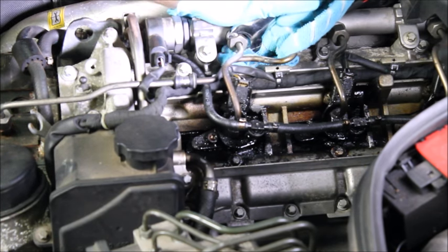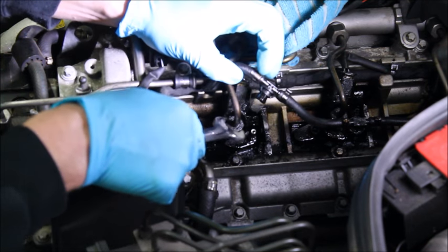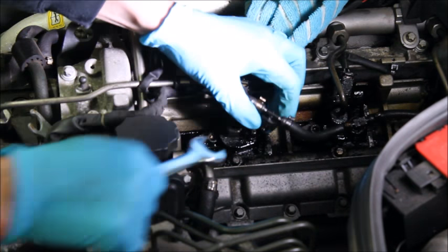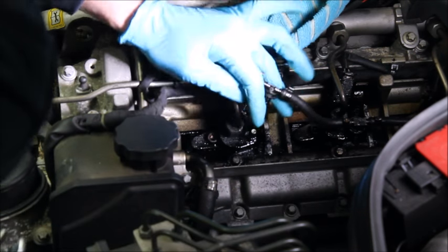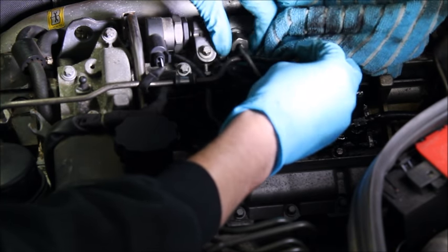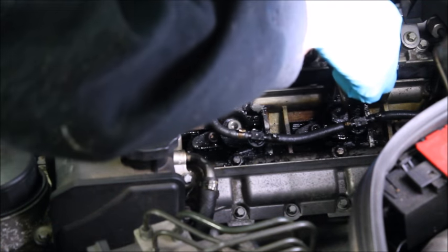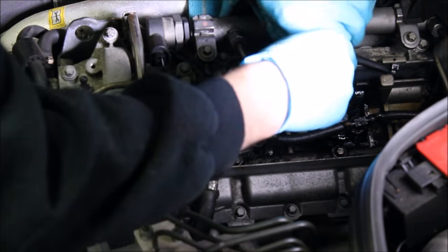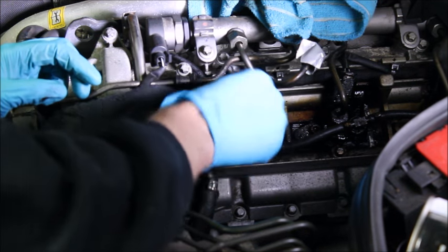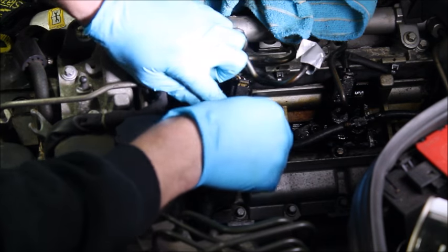Next you'll need to disconnect the diesel supply pipe. To do this, loosen it at the manifold and also onto the injector, and just keep working on both until you get the pipe free. I recommend leaving it connected at the manifold side so you can spin the pipe out of the way — it becomes a useful hanger for keeping pipes and electrical cables out of the way. At this point, apply some tape to the open end of the diesel supply pipe and also onto the injector itself to prevent any contaminants getting into the system. I use a little bit of electrical cleaner spray just to clean the surface of the injector so the tape will stick to it.